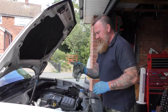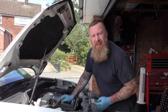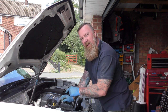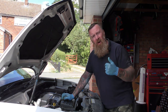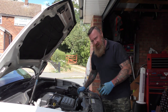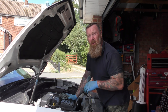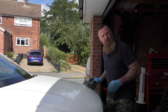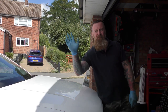And there we go — four plugs nice and easy, air filter done, underneath tray out, oil filter done, fresh oil in. Took three and a half litres out — that was from the main dealer doing that. Yes, they burn a tiny bit of oil. Four and a half litres in — it was a whole litre less. Lovely clean oil in there. The wife just started it and it's got a nice sound to it now — it's got a little turbo in this. Took it around the block, good as gold. We've topped up the antifreeze — that doesn't need doing for another 30,000 miles — and we've done the screen wash. I've just checked the brake fluid as well, all good. Anything else I could do is check the tyre pressure, but we had four new tyres put on it recently. Job done — clean the car, drop the bonnet, simple as that. You take care of yourselves, bye bye, watch my videos.